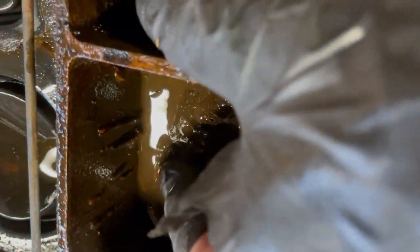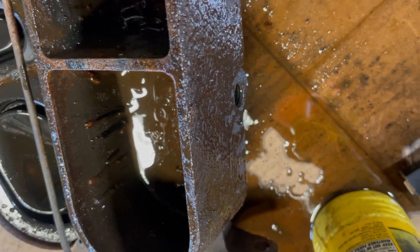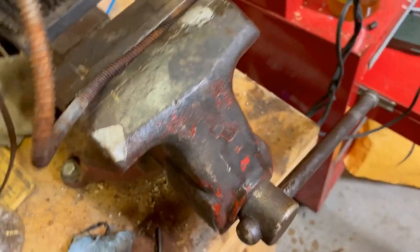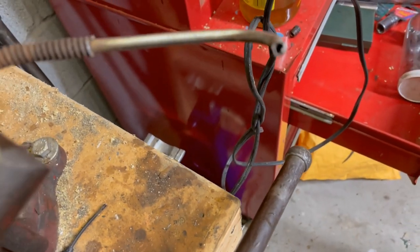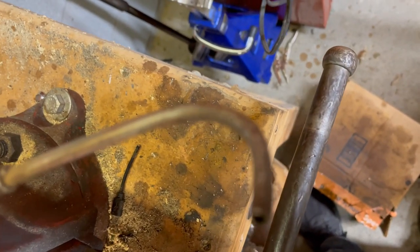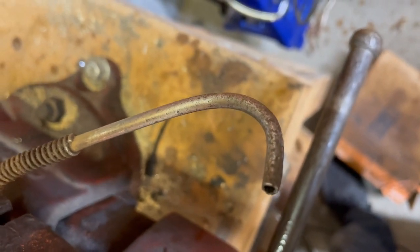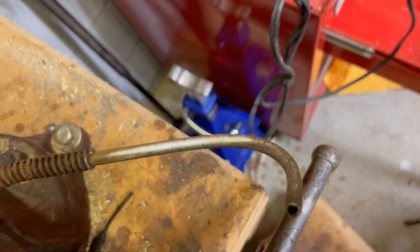Wow. It's almost like someone put dirt in there. I'm hoping the master cylinder I've got works, because if it doesn't, this one's going to be tough to rebuild. I've got the line out - the one coming from the combo valve - all the way down to the piece that broke on the master cylinder. Now I'm going to cut it and re-flare it. You have to be careful because see how pitted that section is - you can't use that, it's too shot, it's not safe. So I'm going to cut all that out and cut down where the tube is in good shape, then bend it once it's back in the truck.